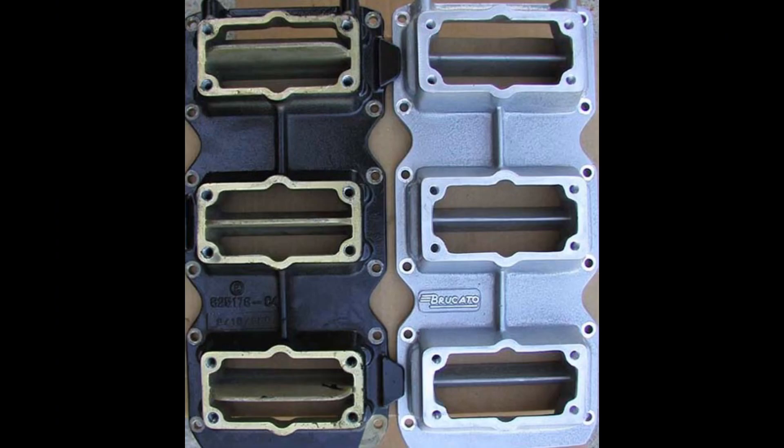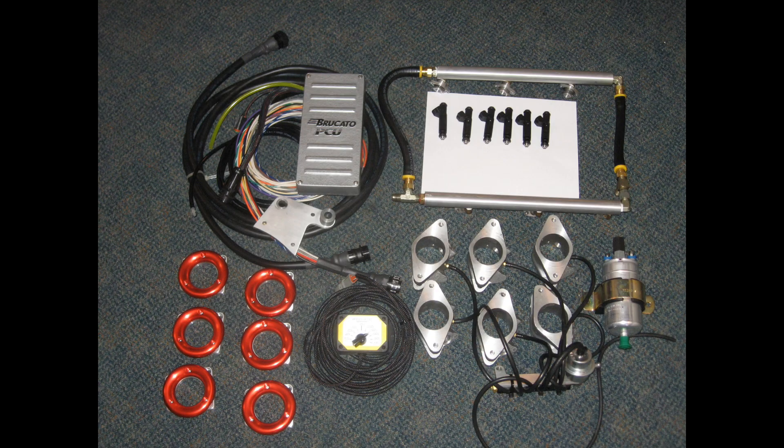Here's a whole pile of raw castings ready to be machined. Here it's mocked up on a 3-liter Mercury motor — the black manifold is the stock one. The difference is the internal profiles, the divider plate, and the transition going into the reed cages. It picks up about eight horsepower on the dyno. We used to do those all by hand; casting just made it easier.